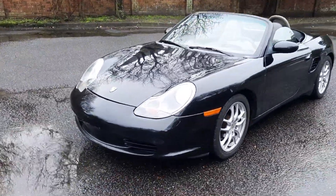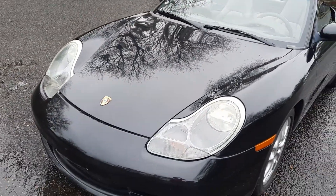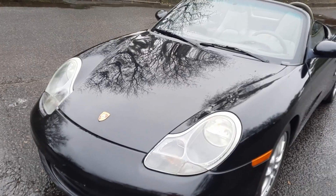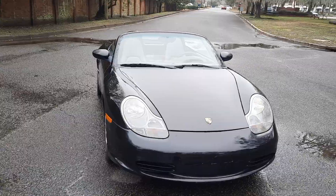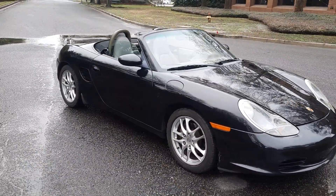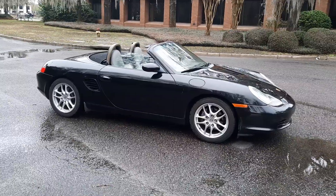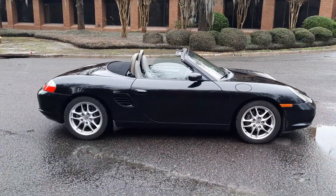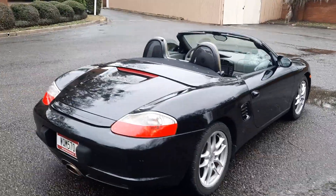Moving around to the front, there is an upward dimple in the hood right here. It's really hard to see — well, there it is, you can see it. I see that all the time; it's from people loading up the frunk and closing it. There's no guard or buffer or insulation and it's really thin metal. Normally I see it up by the battery where the vehicle's been jumped off with clamps on the jump box, and then the hood shocks are no good and the hood falls down. Which also is unfortunate.